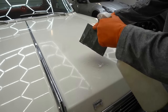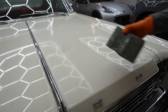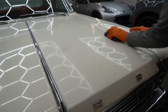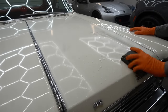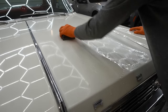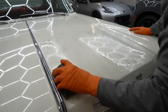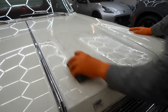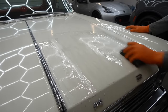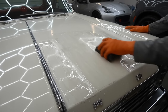If you were planning ahead like I wasn't, you would have these sheets, or if you're using discs, already soaking in water. And let's get started. We just want to safely shave some of this dead paint, some of these dead paint molecules from the surface, flatten things out. As we are doing that simultaneously, that will help with some crisper reflections.